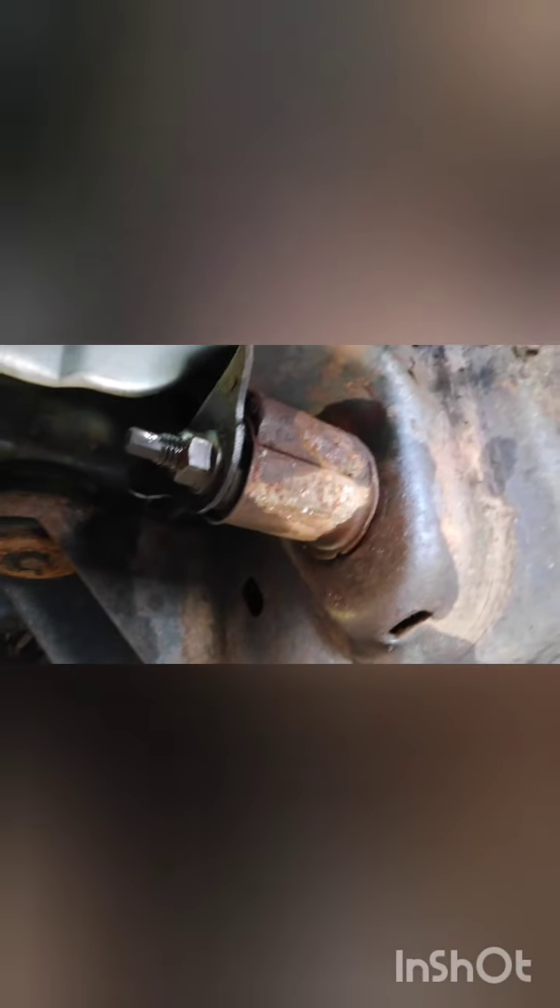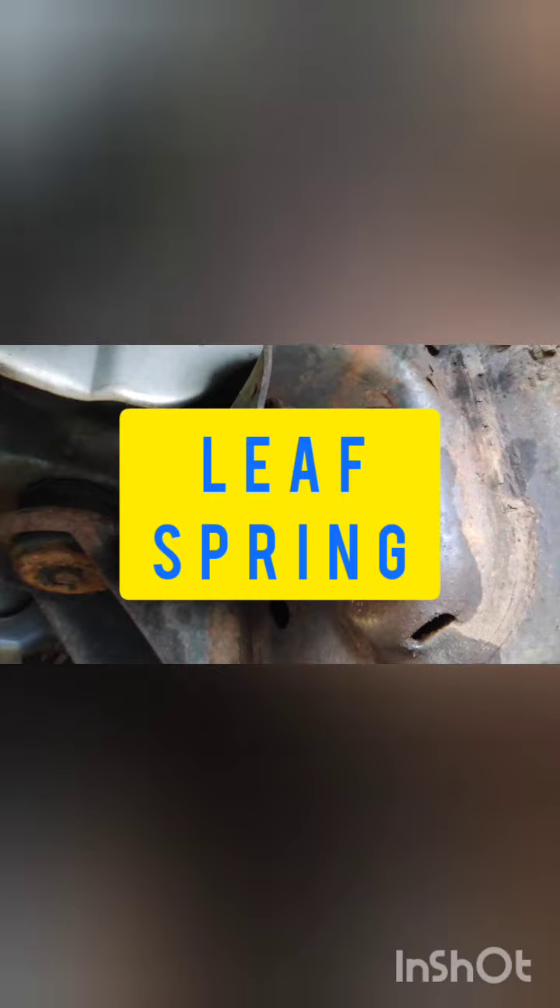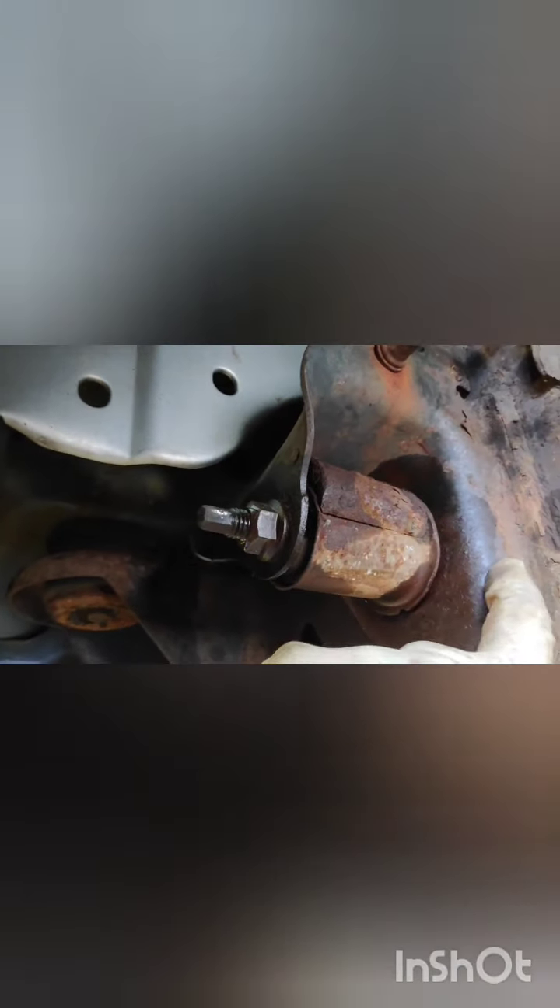I just need to get that bolt out of the bracket, and I'm gonna try something new. Here's the thing: to replace the front bolt or remove the leaf spring, you need to lower the tank because the bolt is actually on the inside — it goes through the frame all the way out — and you're gonna need to drop the tank to get to it. So I'm gonna try to release this nut and move the bolt a little bit towards this way.